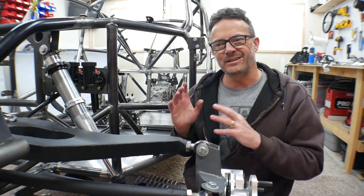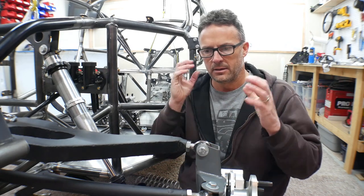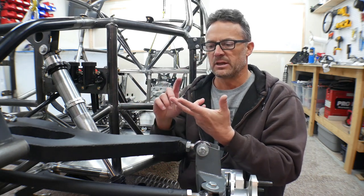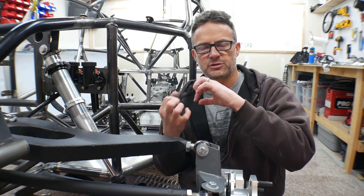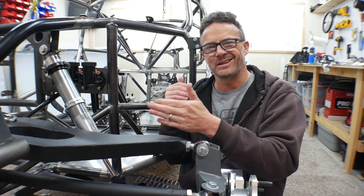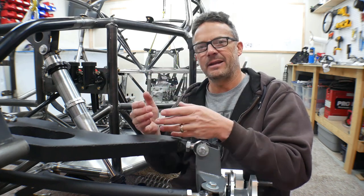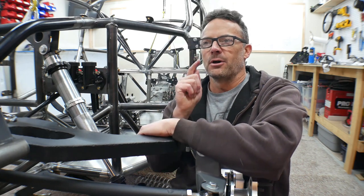The next step is I need to figure out how I'm going to build the dashboard so I can figure out where my steering column is going to be. Now that I've got this stuff out of the way, I can kind of start wrapping my brain around that. That's typically how I do things. In an area like this where I've got the suspension, chassis, brakes, steering, where there's so many things coming into play at the same time, I try to break it into smaller pieces. So I said, I'm going to forget about the steering wheel and the dashboard for now, because that doesn't tie in too much except for the steering shaft to this front area. So let me figure out the front area first, which I just did. That is done now. Then I can take a step back, put the seat in there, and see where I want to set up the dashboard and how I want to do that. So that will be the next video.